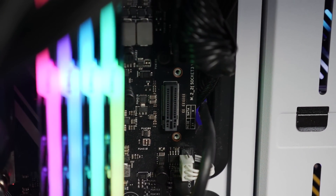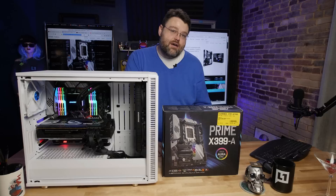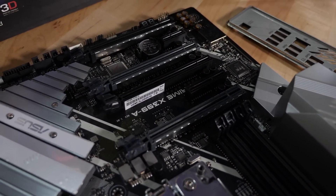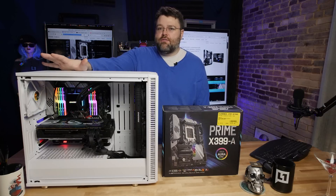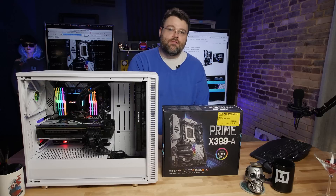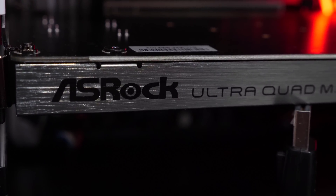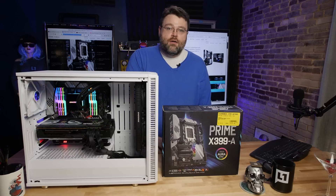In terms of onboard M.2, there are two — one vertical, one under the heat sink — and then of course the U.2 interface, which you can break out into another M.2. You can also use M.2 to U.2 adapters, so you can have up to three U.2 interfaces on this board without using a PCI Express breakout connector. There are three physical x16 slots; the slot directly under the primary slot is x4 from the chipset at PCI Express 2.0. There's also a PCI Express x1 slot, also PCI Express 2.0 from the chipset. You can use an M.2 breakout card to run four M.2 drives, and the UEFI has options to take the x16 slot and break it into four x4 slots for four NVMe RAID — and that works really well.